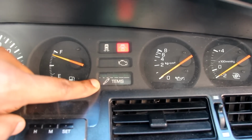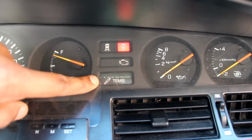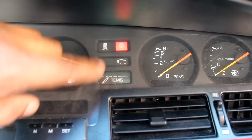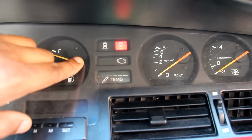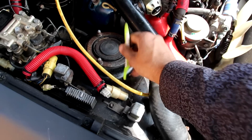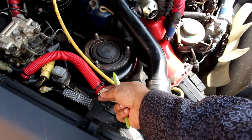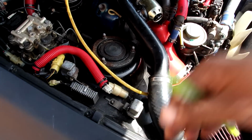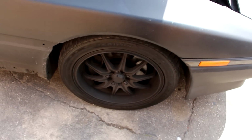Now in modern days you'd find these in some Lexus vehicles, and it would basically modulate the suspension shock absorbers based on road conditions, or a flick of a switch inside if you wanted it stiff or hard for the track. You can see next to the strut you've got an empty wire where the electronic modulated suspension would sit. This one's been removed obviously because that system is pretty expensive to maintain, and a good set of coilovers could probably do a better job in modern times.